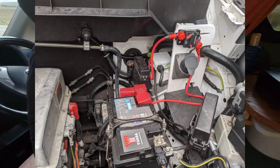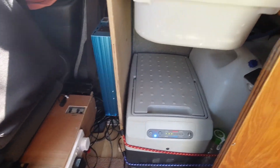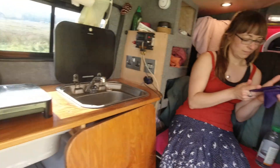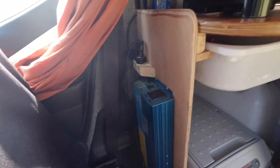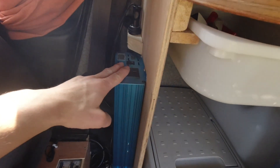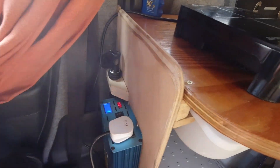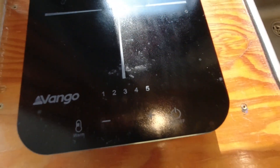I'll put up a picture here on the screen. So this obviously works when we're plugged into a 240 volt hookup, but if we want to cook here off-grid, there's no sources of power anywhere around here. Previously I would have used a 12 volt kettle or a gas stove as a backup, but now I've installed this 1.5 kilowatt inverter and run some hefty cables from the battery inside the bonnet to this inverter. So when we want to cook, just unplug the hob from here, plug it into the inverter, switch it on — the induction hob is now on.